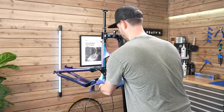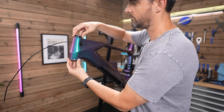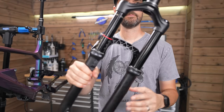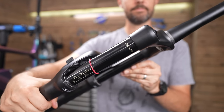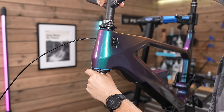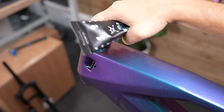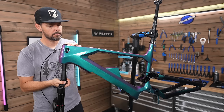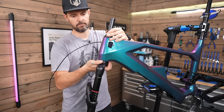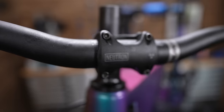When it came to assembling components to the frame, I started with the dropper post first so I could use it as a stand holder. Then it was time to install the forks and suspension — again it's all pretty standard, straightforward stuff. There aren't really many specialist tools you need other than a bearing press, and you could buy one and use it again later or ask your bike shop to do it. That really is the hardest part — pressing in the headset bearing. Cutting the fork and getting all the shock and components to fit is just like a regular mountain bike.